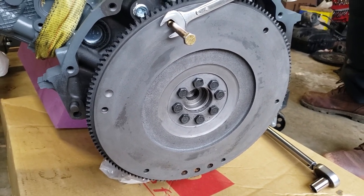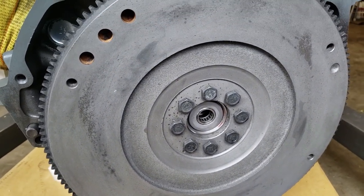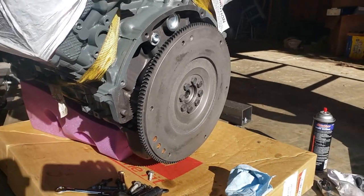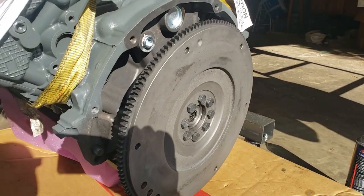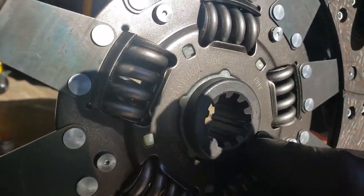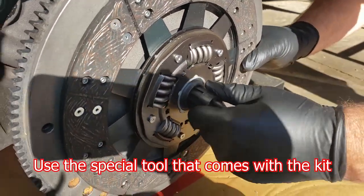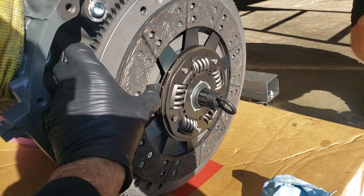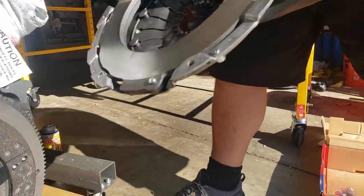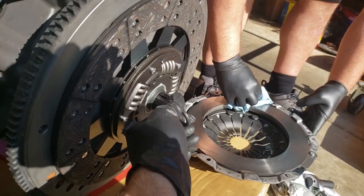All of them are on and torqued to 70 foot-pounds. We've cleaned the surfaces really well, the pilot bearing is in, and now it's time to put the clutch on. We're going to use this nifty alignment tool that was shipped with the package. There we go — it says 'flywheel side' right on it, so you know which way it goes. Now for the fun part: these things don't feel good on your fingers if you get them wrong. We need to clean that with brake cleaner — you can see the whole setup right there.